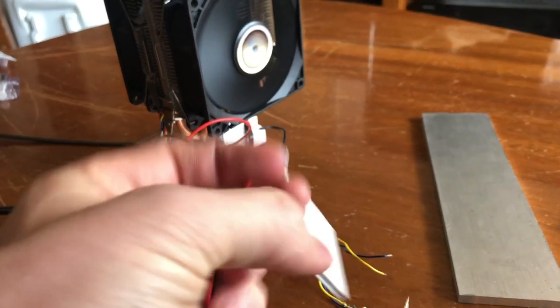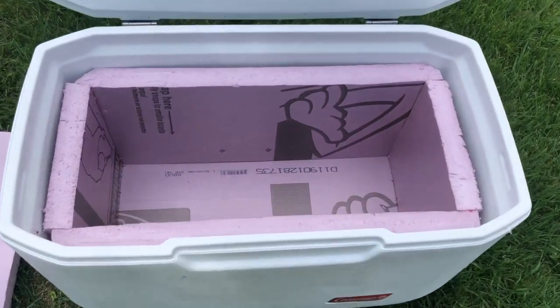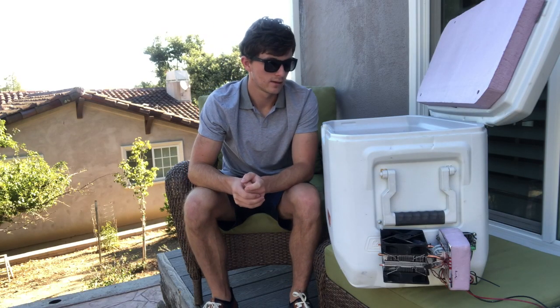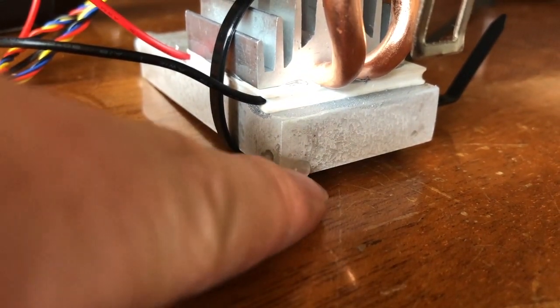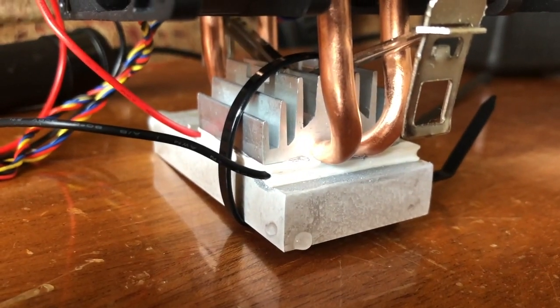There is a big issue with the thermoelectric cooler that we haven't talked about yet — it's just a limitation of today's engineering. No matter what you do to make it efficient with insulation or fans, it's still limited. What I'm saying is: if it's higher than 57 degrees Fahrenheit outside, the cooler can't stay cold enough to keep your food safe. Below 57 degrees, you're fine. It can only achieve a certain temperature differential between outside and inside — it cannot cool off that thermoelectric device quickly enough.